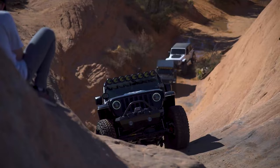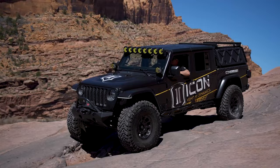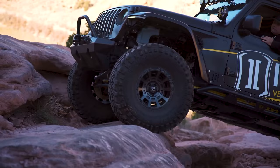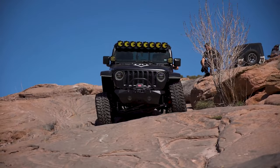This is exactly why many avid off-road enthusiasts will purchase quick disconnects like the ones from JKS Manufacturing, or why several automotive brands will include an option for an electronically controlled disconnecting anti-sway bar or a hydraulically controlled sway bar disconnect like on the new Ford Broncos. Anti-sway bars work great for on-road handling, but handicap our vehicle's off-road performance by not allowing the suspension to work at its maximum articulation potential.